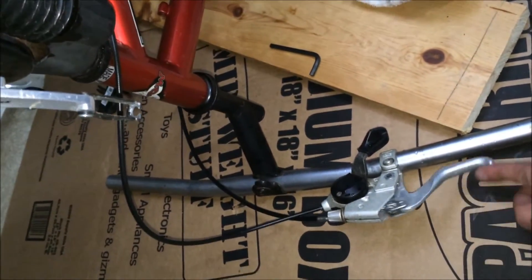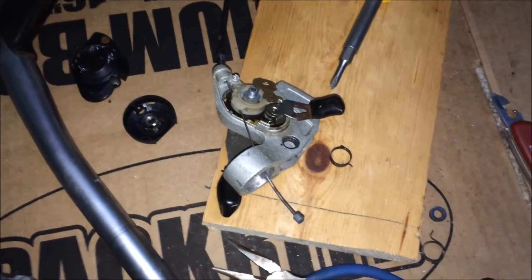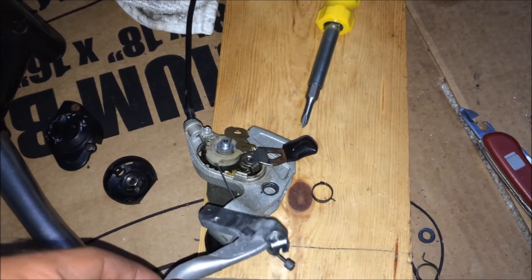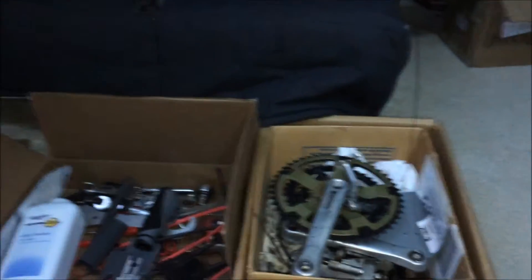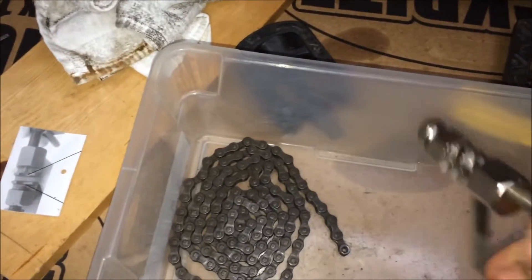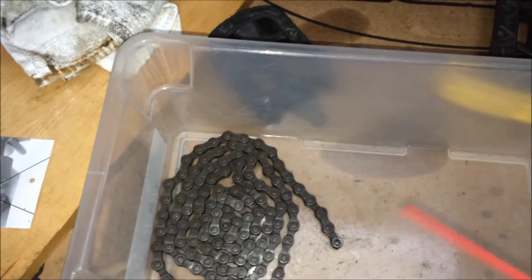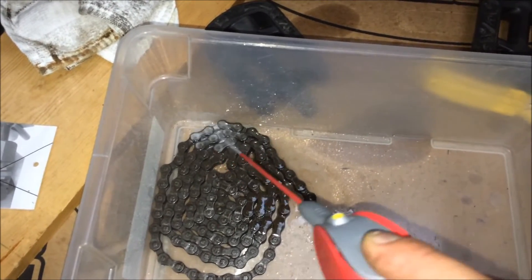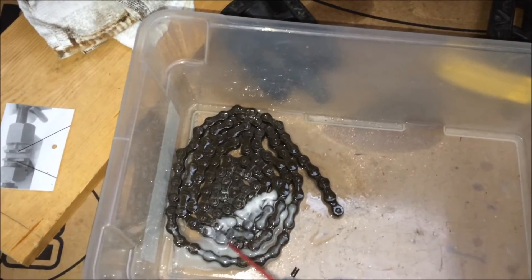I just need to remove this brake lever from the shifter. The shifter needs a little bit of work — the pawls are stuck, so I've got to spray some WD-40 and lube in there. There's the shifter mechanism disassembled. I had to drill a pin out in order to get this lever off. I'm going to have to clean up inside of there and figure out how to put it back together. Here's the chain taken off the bike. I used this tool to push a pin out of a link so that I could take the chain off. Now I'm using WD-40 to clean the chain. WD-40 is not a lubricant, it's a solvent — sometimes it works as a lubricant because it'll re-liquify whatever grease is already on what you're spraying. You should really use it to clean off old grease and then reapply new grease.